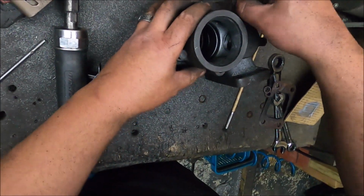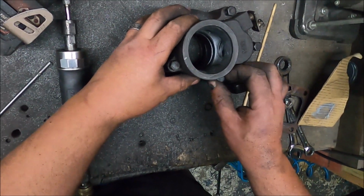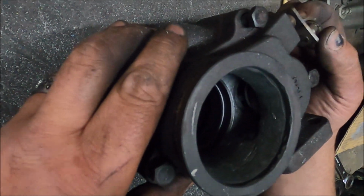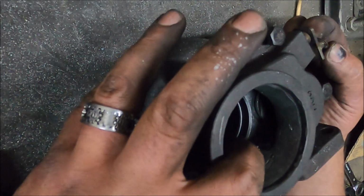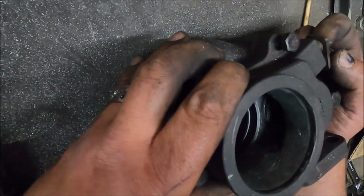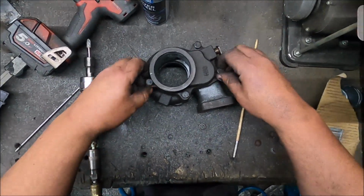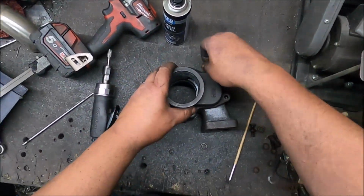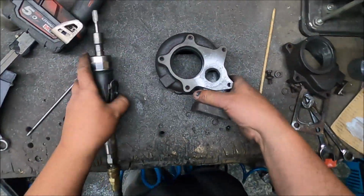Especially when there's obviously a little bit of wiggle room in things like this, so you don't want to go too far and then mount this slightly off so it's a bit much. I reckon a little bit more there. I don't want to go too close because of the wiggle room. Yeah, a little bit more, and then smoothing it internally so it's a better flow from the main turbine inlet path to the wastegate itself.